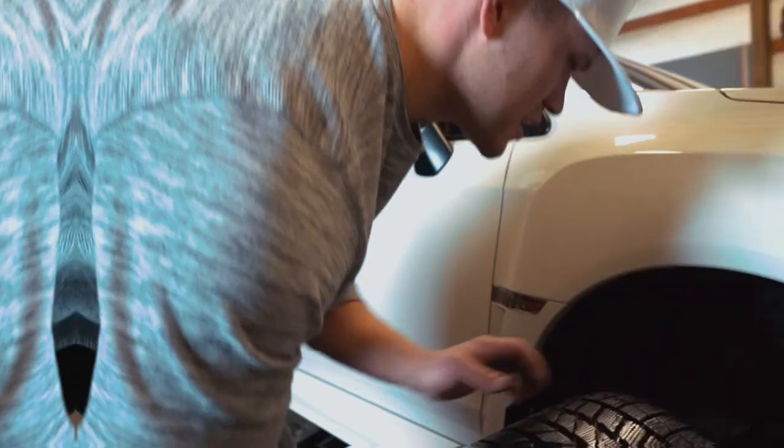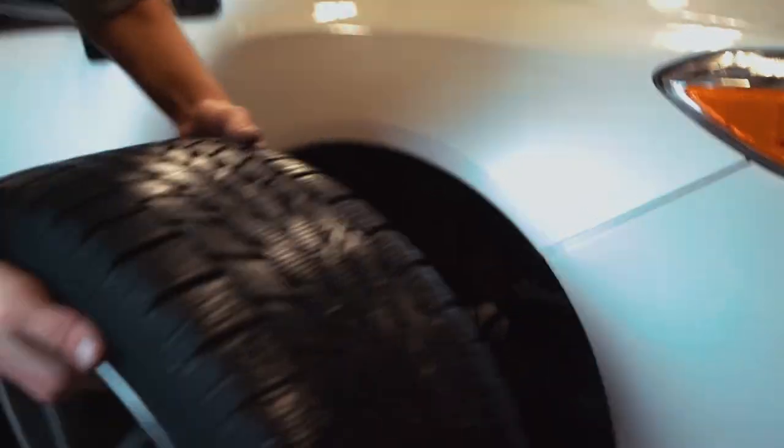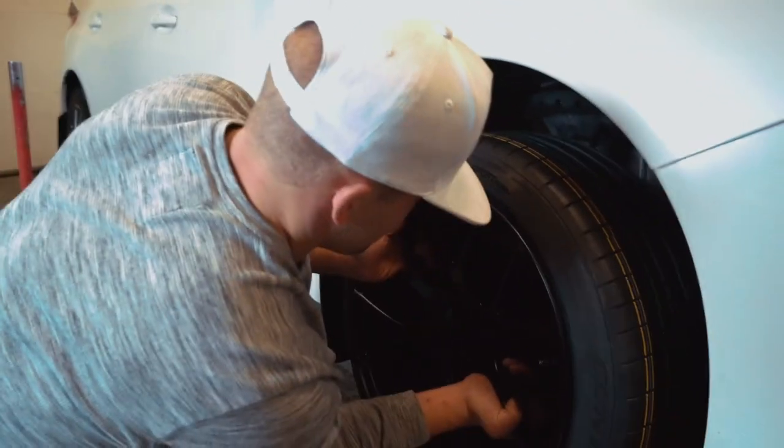Unfortunately they poke out a little bit too much. So what I'm having to do is max out the front camber adjustment with the factory bolts, and in the rear I'm just gonna roll the fenders and call it a day. The fronts are gonna be pretty flush — straight up and down how they should be — and the rears are gonna poke out a little bit. It is what it is. I'm running 10 and a half on my car and these are only nine and a half, so that's crazy. He gets the car in a few days and I can't order a new set of wheels, so we're gonna make this work.